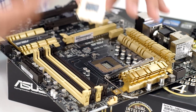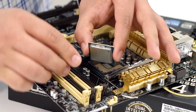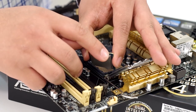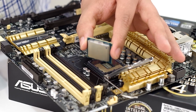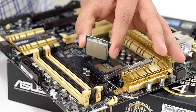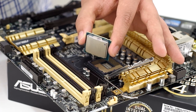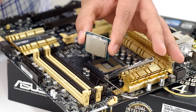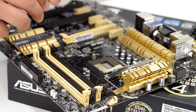You're going to want to make sure and not put the CPU in backwards. There are notches right here — one notch there and then there's another notch corresponding in the same position underneath it. Those two notches align with notches inside the CPU socket. All you need to do is align them. If you're not aligning them correctly, you're not going to be able to install the CPU successfully — you'd be forcing it inside.